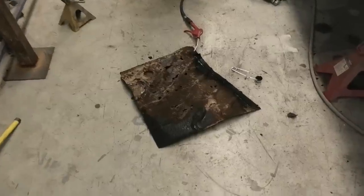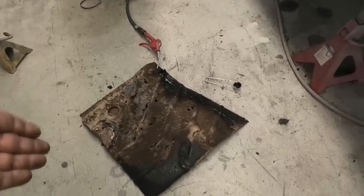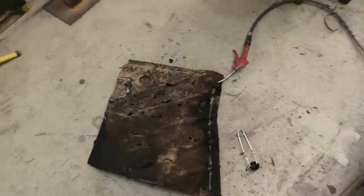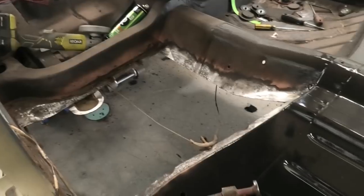My plan is to drop the floor pan into the hole, spray a bright colour around it, use that as my do-not-cut pass line, and whittle out the majority of the floor with an oxy set. You could probably use an angle grinder - I personally hate them with a passion. I'm going to use an oxy torch because I have the technology. The floor is now out. I did have to resort to the angle grinder because that coating on the bottom kept catching on fire and making toxic smoke and nearly wiped me out. So we went back to the angle grinder.